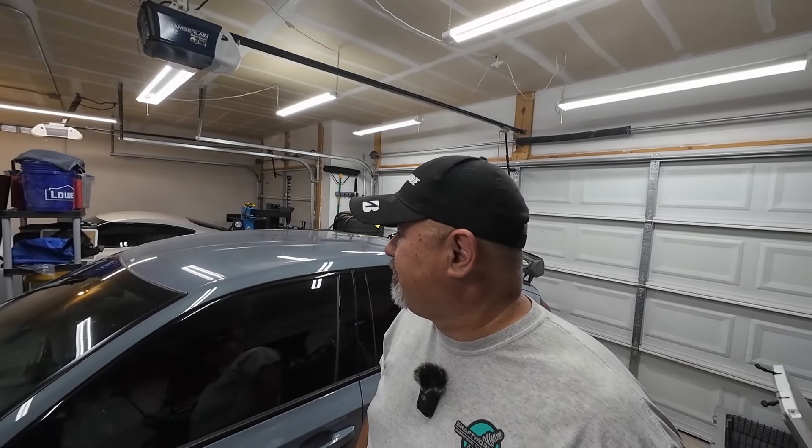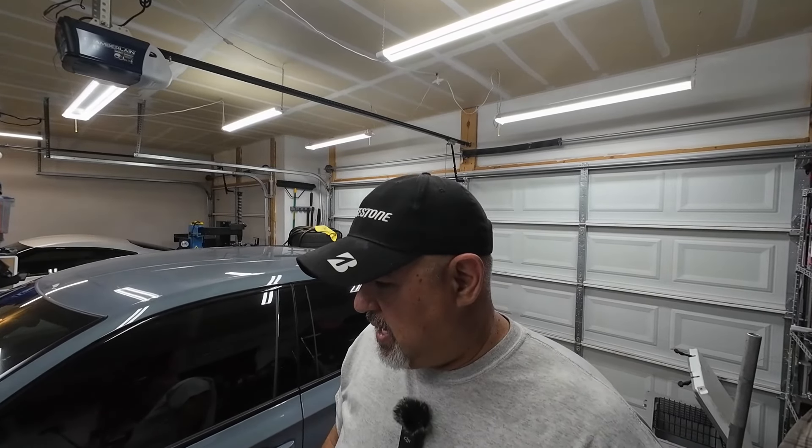The next event is going to be the Supra. The changes are really minor — the biggest thing is drivability. I need to learn to drive it better in second gear out of slow corners. The way my tuning is set up, I don't get max torque in second gear until it's really high in the RPM range, so I've been short-shifting to third, which defeats the purpose of my tune. The problem is that in third I get all 530 wheel-torque at once and light up the tires at about 45-50 mph. I've installed a Dauntless LED shift light on the dash hood to encourage me to ride out second gear all the way to 50. Next video will be on the Supra, but for now the Civic Type R is working well — in three weeks we have another event with it at Farmington, and we'll see how it goes.